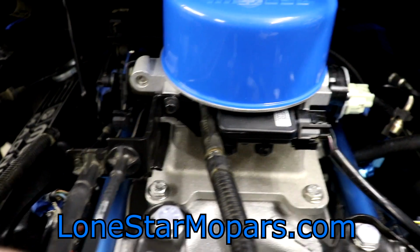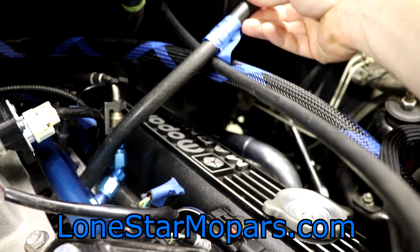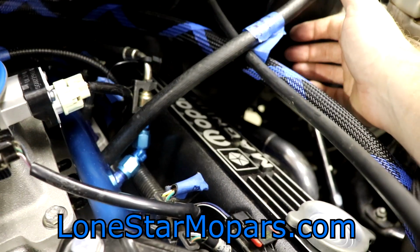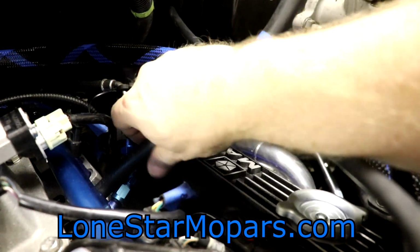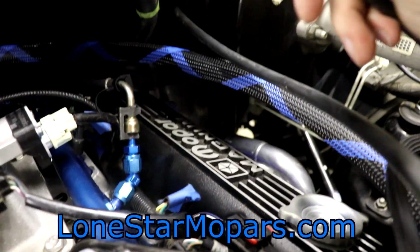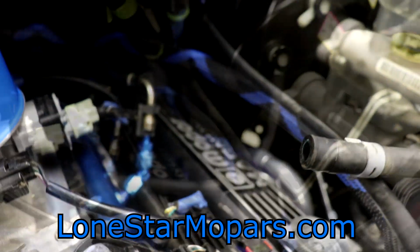So, anyway, what we're going to move on to now is our brake booster vacuum line. This sucker coming in, again, it will fit, you can route it differently, but it's just insanely tight. So I grabbed some more 11/32 vacuum line, and I will rip this guy off. Oh, there's a clamp there. Good to know. And we will get that sucker tightened up.